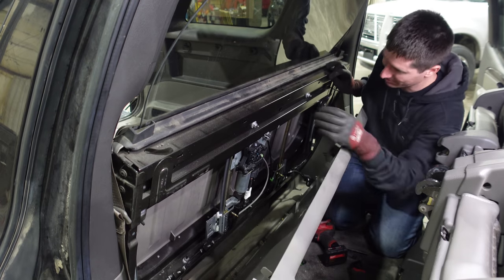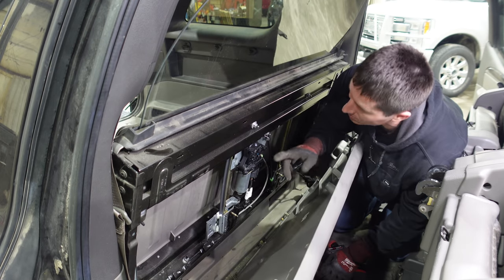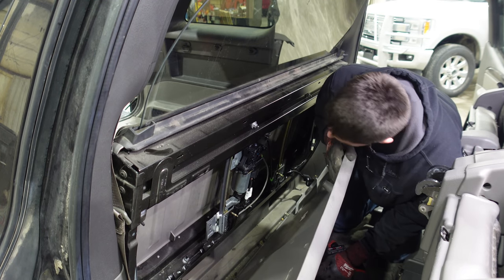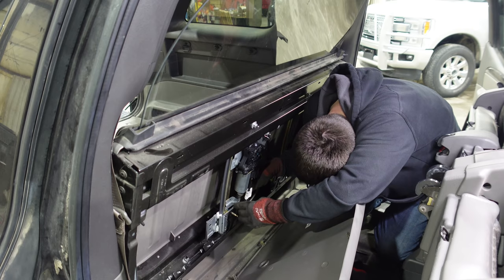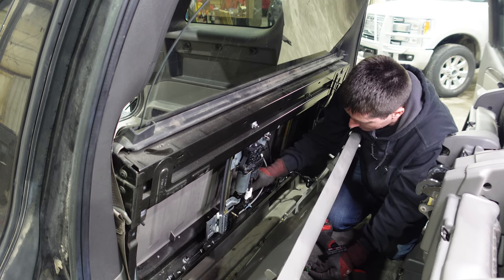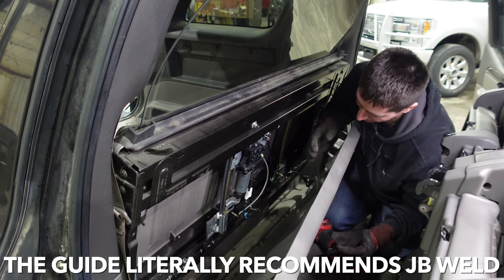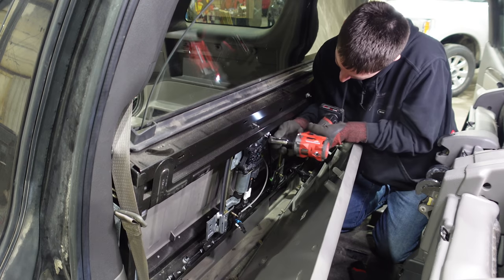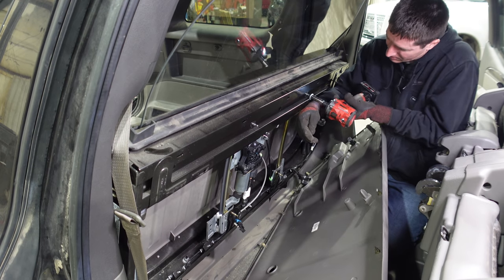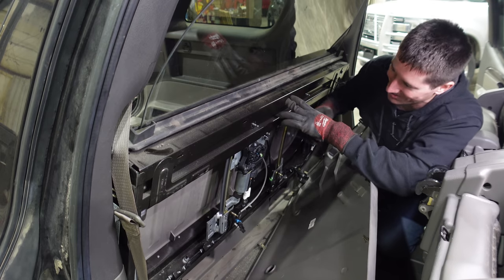Here's the regulator motor. There's a clip right there on the back, and there's another switch here that tells it the window's closed — you'll need to remove that. There's another 13, another 13, another 13, after you get those bottom ones out that are hidden under the covers. This is an easy job other than those two connectors right there. Mistakes were made — it's really hard to get that thing off. But the bottom still clips on. I think all of these have been replaced multiple times in every one of these cars. They break a lot — it's very common.